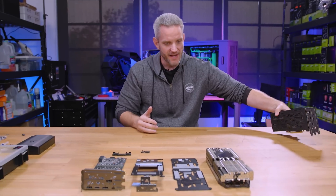Okay, this should work — oh yeah, there's lots of room there. Normally this touches the VRMs directly on a motherboard so it uses a thermal pad. But because we are now going metal to metal with a heat spreader that's conducting heat through a thermal pad already, I'm hoping there will be enough thermal conductivity. I'm going to pre-spread it because I don't want it to squish out the sides. I'll place it right on top of where the actual VRMs are so it can get a more direct path of cooling. Looks like it was on there tight — that ain't going anywhere.